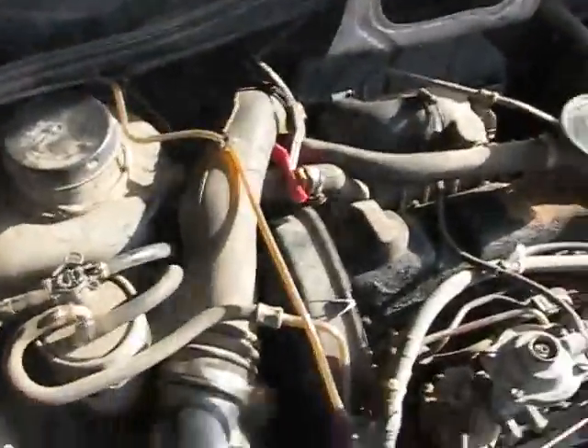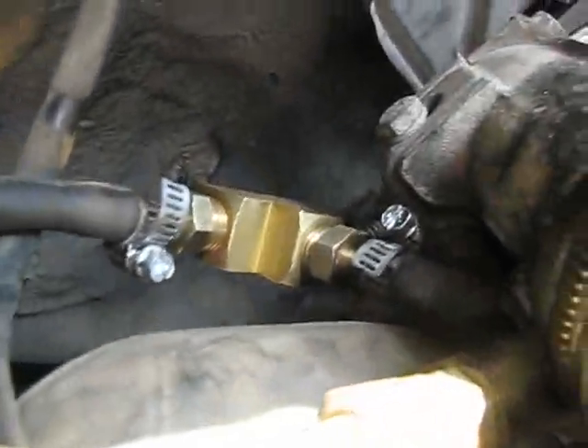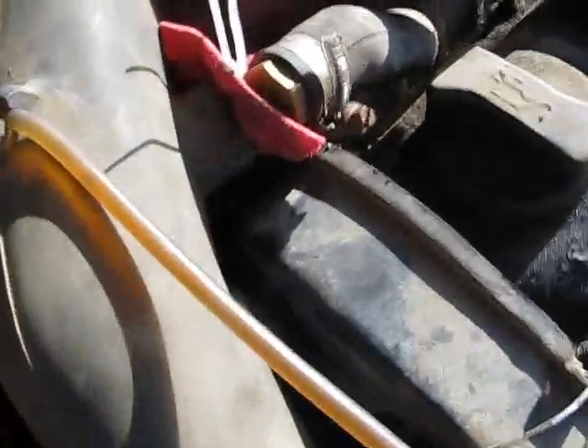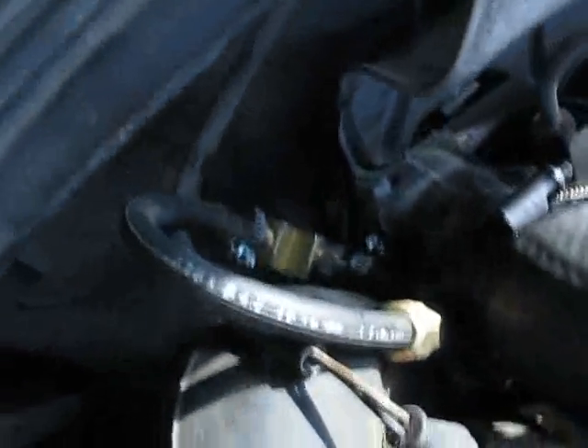It's Saturday now - supposed to work today but the laser's still broken. Anyway, I've been tinkering with the motor. I installed my boost controller right there and it works awesome. It's set to about 15 to 18, but it's actually set at 20 which I guess is all right. Under here - that's the blow-off valve. The stock one is set to about 12 pounds, so when I had it set up the boost would go up to 15 then drop to like 8.